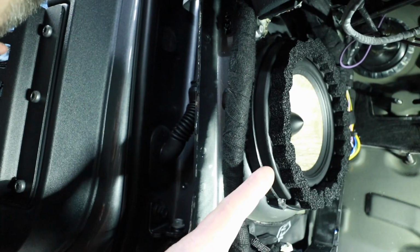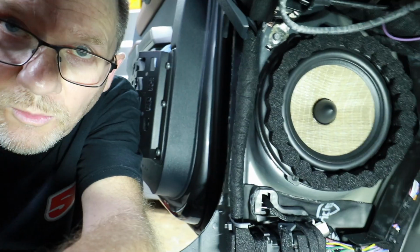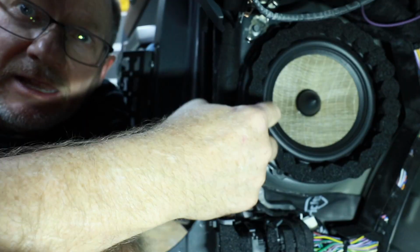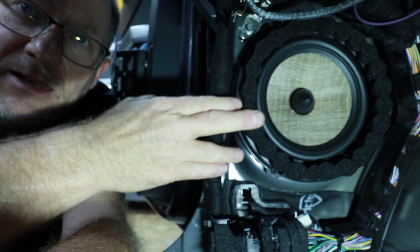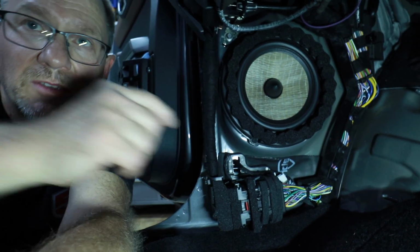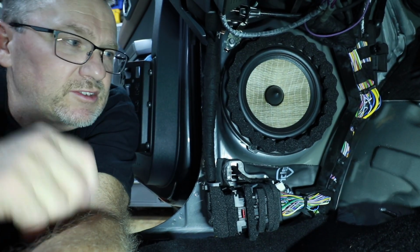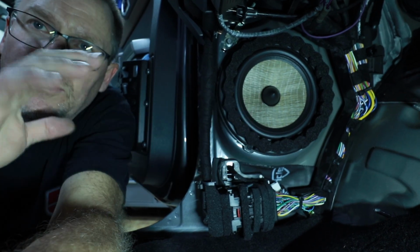into place. And this is why we wanted to add that top layer to it so that we could put that foam right on top of that speaker without doing any damage to it, without getting it anywhere near the surround and screwing that up. Panel goes right in and sits on top of this. He did cut the sound shield gaskets in half because we didn't need a full inch, we just needed a 1/2". It's like a 1/2", 3/8 of an inch. But that allows that bracket to go in there and sits right on there, which is fantastic.